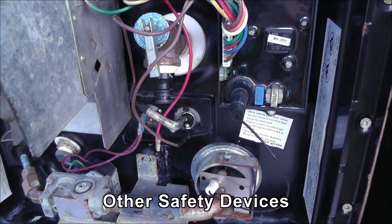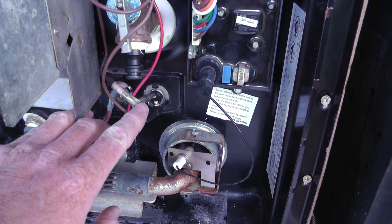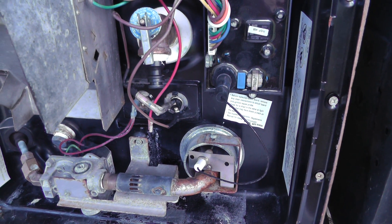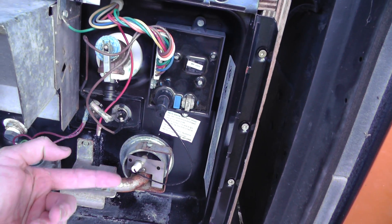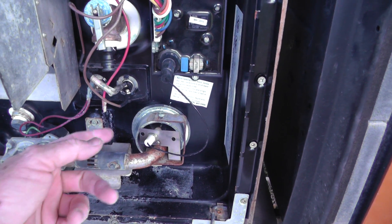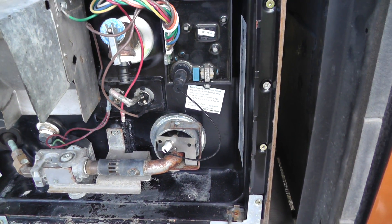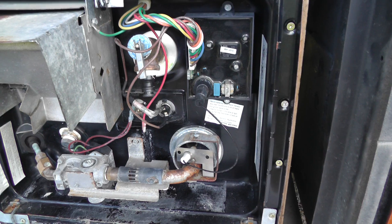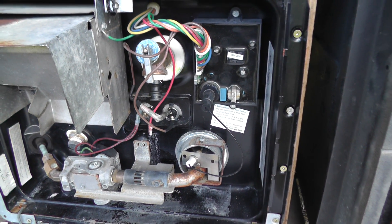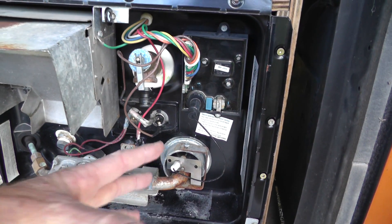You've also got two more safety devices. First, there's a device inside a plastic sleeve which is essentially a thermal fuse, and its purpose is more related to the gas. If the outlet is somehow blocked, or if a lot of wind was blowing in and blew the flame back out of the tube, it would heat up this area and eventually trip that thermal fuse. That thermal fuse is different from the thermal switches in that once it's been triggered it has to be replaced to restore the connection — it's essentially a one-time trip-off mechanism to detect excess heat in this area.